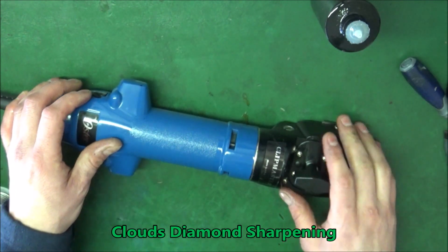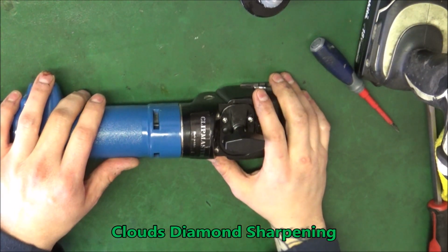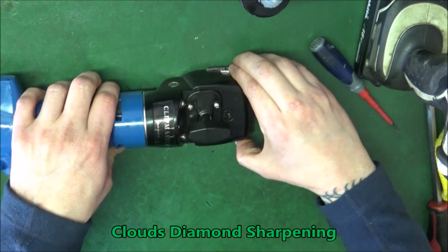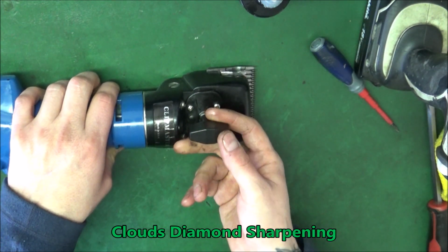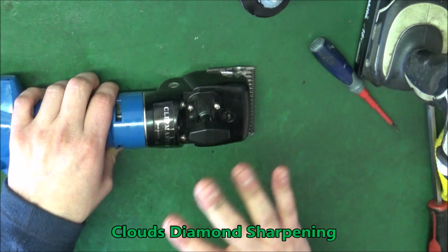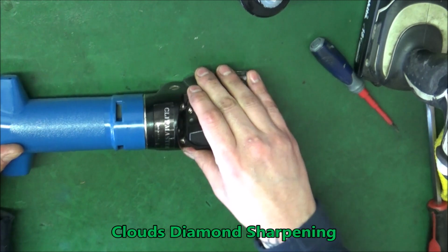And then when it gets all the way down, it's time to get it sharpened, and don't run it when it goes all the way down. Now, sometimes it won't be 5 rotations, it could be less depending on how many times you got the blade sharpened. So for sure, feel and make sure this isn't loose. But usually I recommend 5 turns, and then as it goes dull, go half a turn. As it goes dull, go half a turn, and once it goes all the way down, stop using it. You're damaging your clipper and your blade. So here we go.